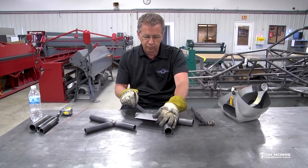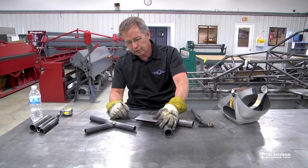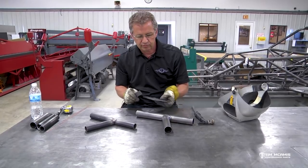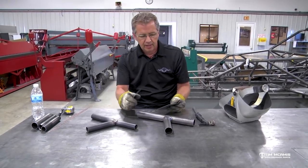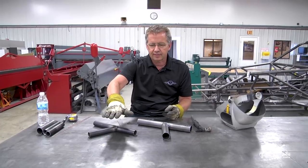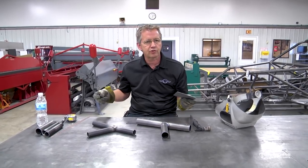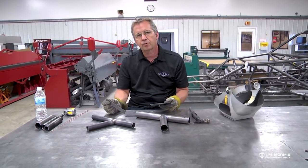If you just weld this in the perimeter, eventually the vibration from the engine is gonna crack these welds — actually it'll crack around the weld — and then you'll have to go back in and re-weld this after you've powder coated or painted the chassis. So these little floor strips go in here, break over, and you drill through and put 6-32 button heads in there. The same way down on this edge, you lay out the welds — mark an inch, skip two, weld along there, flush it out on the bottom of that floor pan. That gives you a nice stiff surface and keeps the vibration out. We have those strips in long lengths, you cut them to length, they're scalloped out, look really nice, and they'll really prolong the life of the floors.